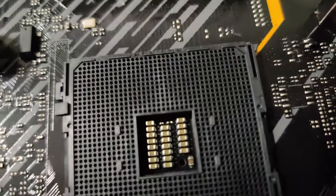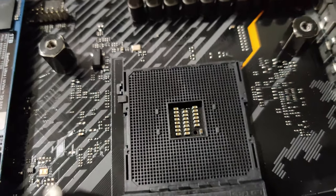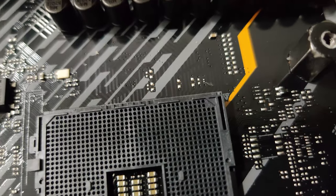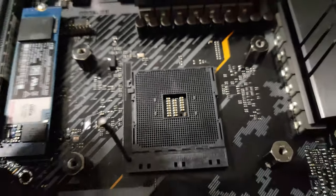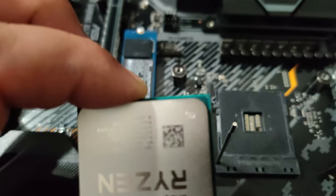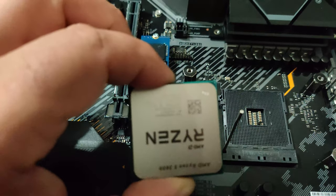So yeah, what you want to do first is come way over here. You're going to start with these ones. You're going to secure the motherboard down to the frame all the way around. That way it's tight, so whenever you put anything in, like your RAM, your fan, your graphics card, or your capture card, it won't put any stress on the board because it's all secured.